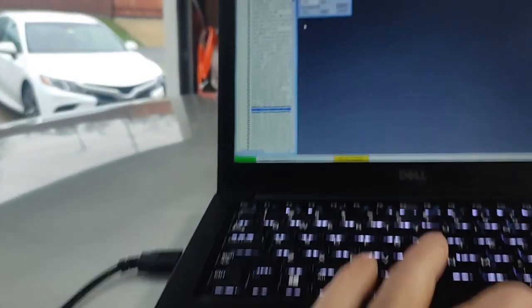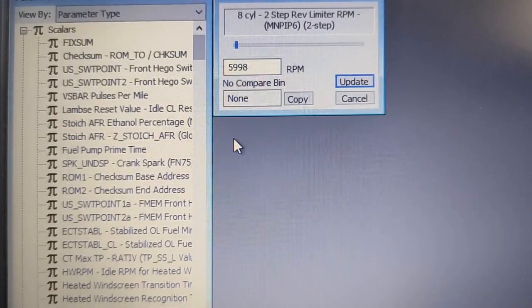I moved the rev limiter up to 6,000 so I could rev it and see if it was popping out of the exhaust. This one uses the vehicle speed sensor — if you're at zero MPH, it'll work; once the car starts moving, it turns off the rev limiter. I think that's a pretty smart way to do it — it probably looks at throttle position and VSS. That way I don't have to wire in separate switches or however people activate those two-steps for launch control off your clutch pedal switch. That's why I'm hesitant about putting the Pertronix in — but I mean, I had it in here before and it did work. I thought it idled a little smoother with the multi-spark.